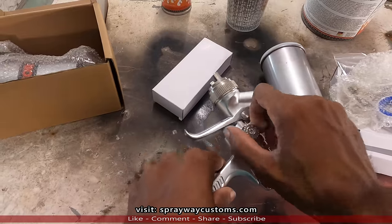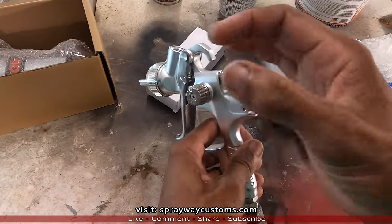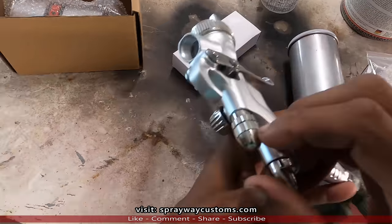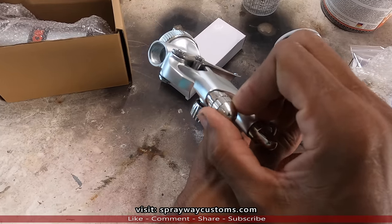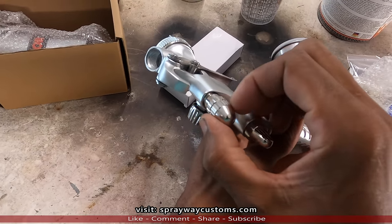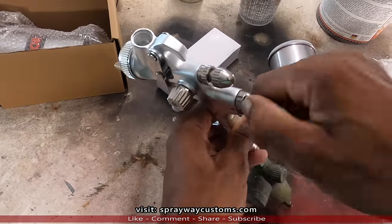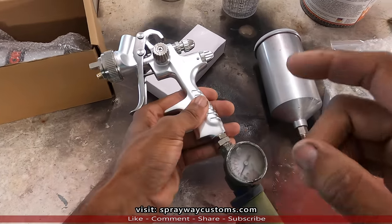I got my fan pattern wide open. And on my material, I screwed the knob all the way in. And you got like a slit in it. Then I let it out 2.5 turns. That's 1 turn, 2 turns, then a 1/2 turn. Then I lock it down. On the air, I got it wide open on the gun, but on the regulator, I'm gonna have it at 30 PSI.